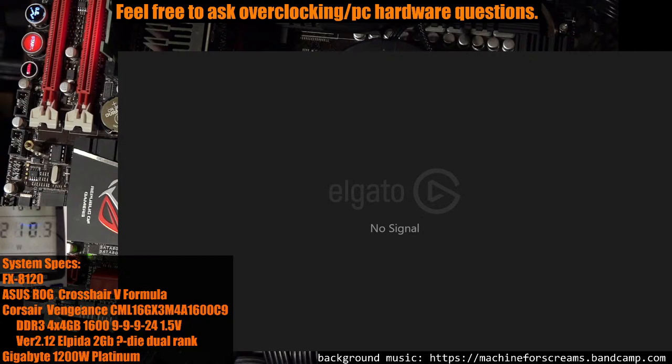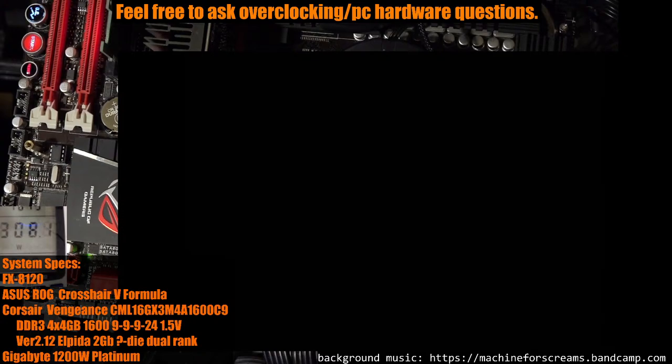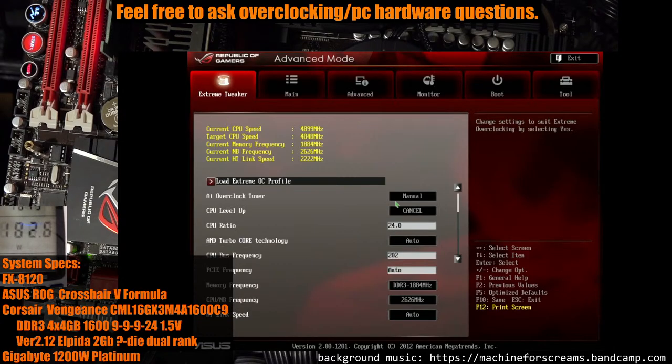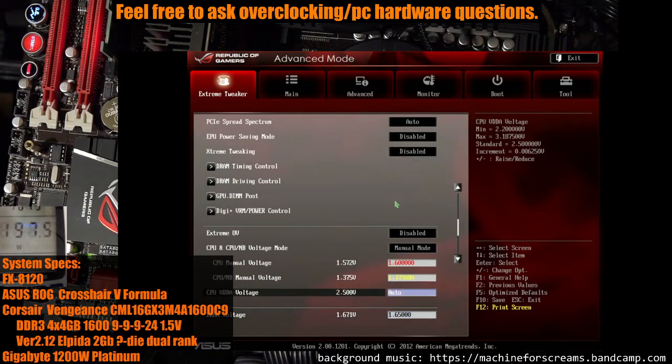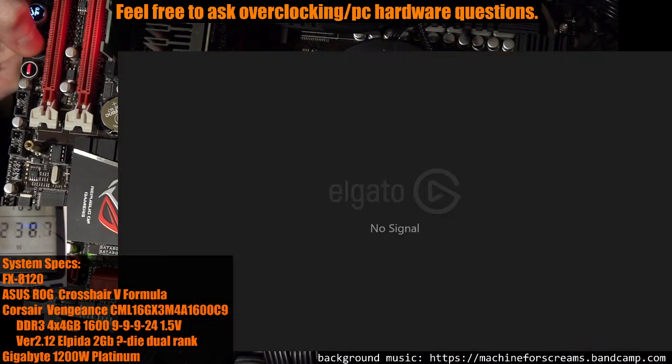Is the core voltage not set high enough? Why is it resetting like that? Yeah, 4 gigabit MFR for max frequency. 4 gigabit BFR is also not too bad, but it's worse than MFR. Is the core voltage too low? And we crashed! Okay, so this is very, very fun. I think this is the memory just giving up.